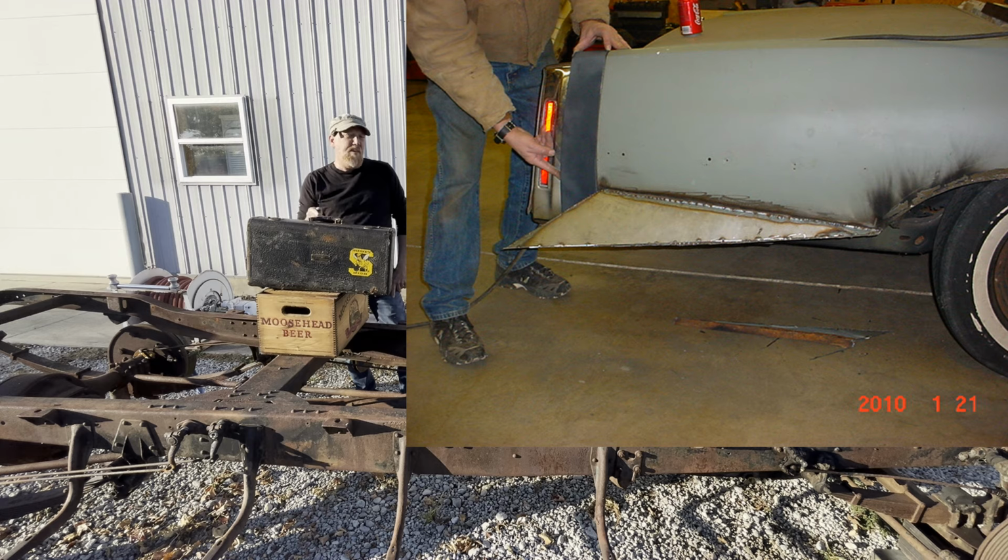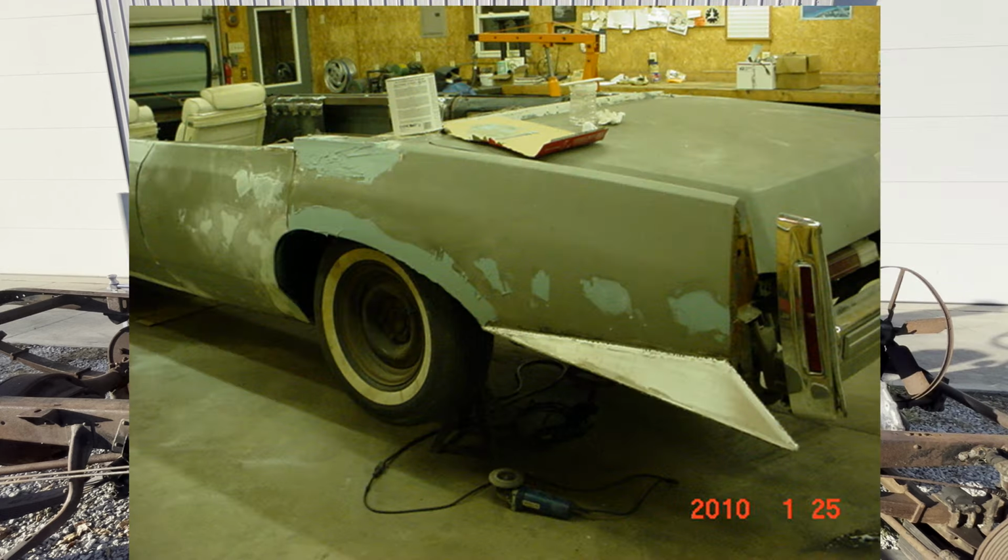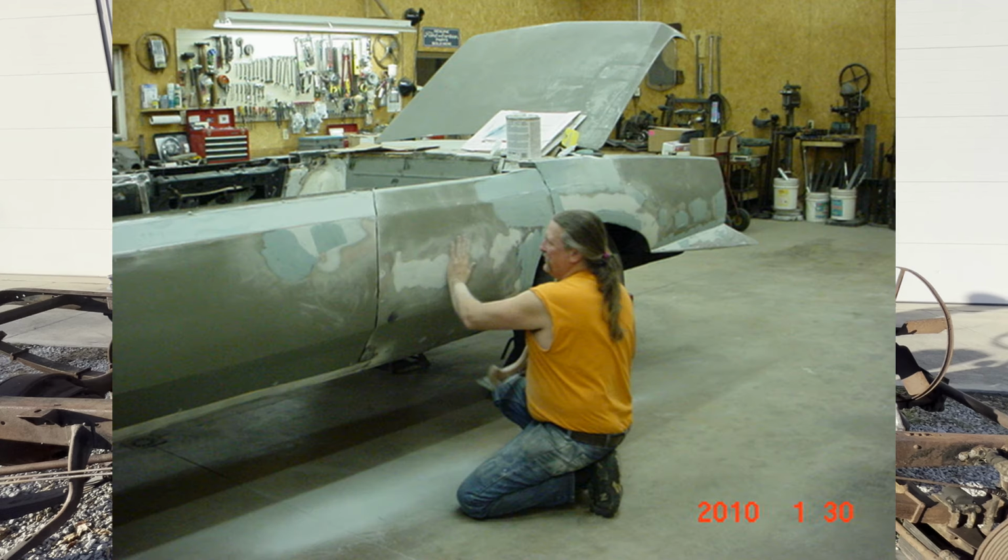So we finned it. That was the next project. After we got done with that, it was time to do the bodywork. We got the sheet metal all fixed up, and Greg worked on some Bondo, because we shaved the whole car. We took off all the side moldings, which had spot rivets holding the molding on. We got rid of the door handles and the mirrors. We just shaved the whole car to make it smooth because we didn't really need any of that stuff.